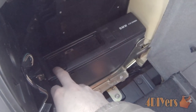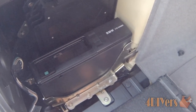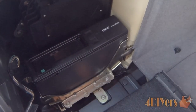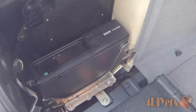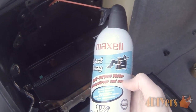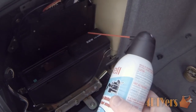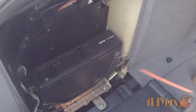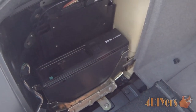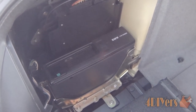Normally when you press the little button it'll release the cartridge out of the slot. I'm having a little difficulty with this one. If you are able to get the cartridge out and find there isn't an issue with it moving in and out, a lot of times you can just take a can of dust-away or blast-away — the kind you purchase for computer electronics — stick the little nozzle inside and blow the inside out. Dust lodged somewhere can cause issues with how it operates.